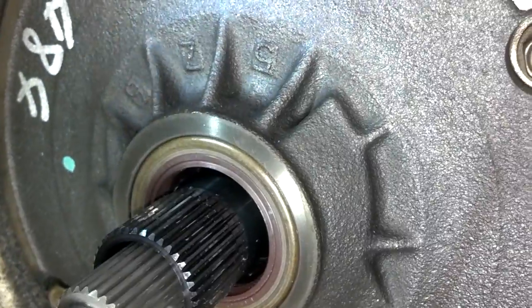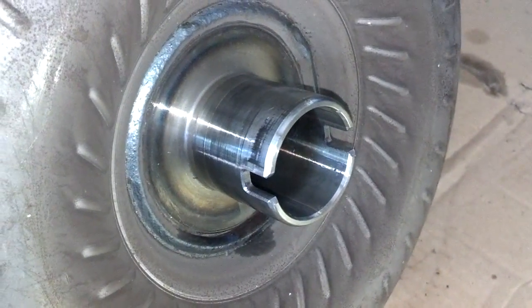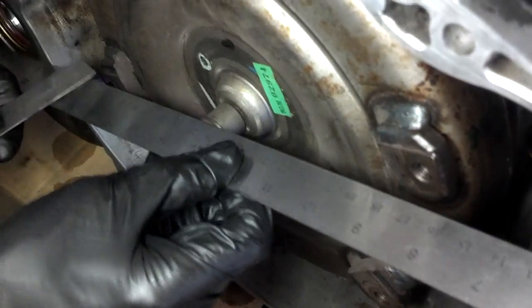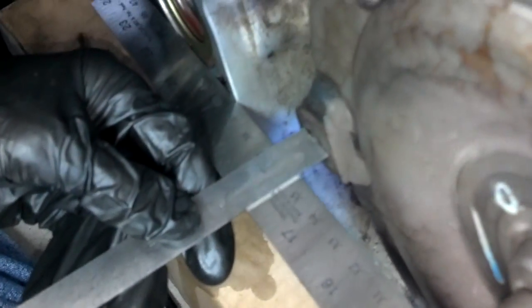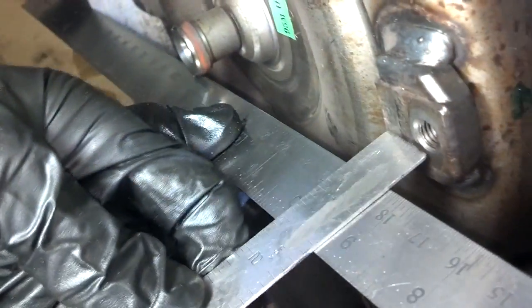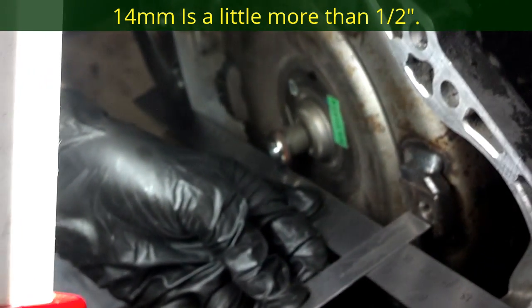That seal actually has a metal outer ring and it is in place, but if you look down in there you've got two tabs down in there deep that the torque converter has to latch onto. So when you work your torque converter in, make sure that those tabs fit over those notches. To make sure the torque converter is all the way in, put a straight edge across the mating surface and make sure you're a little bit past half inch deep on your screw surfaces — that way you know the torque converter is all the way in and your spline is lined up on the inside.